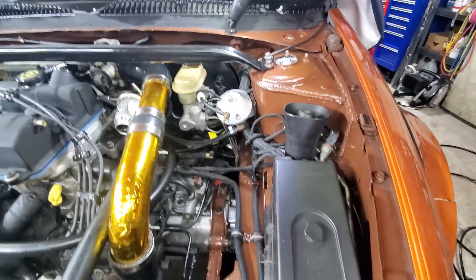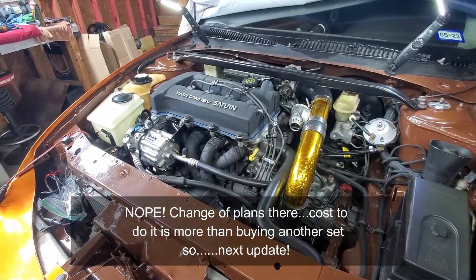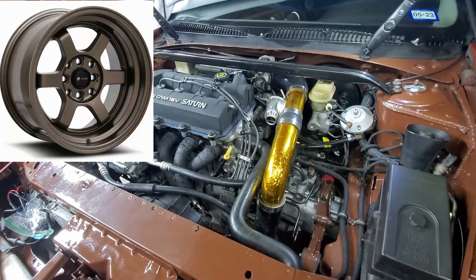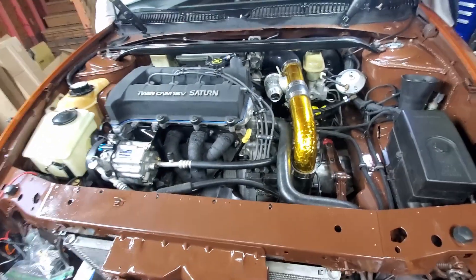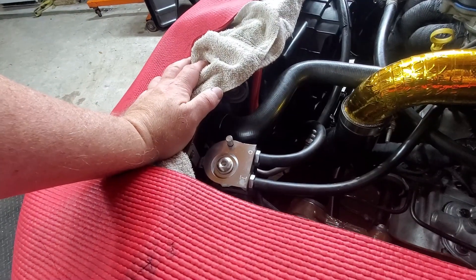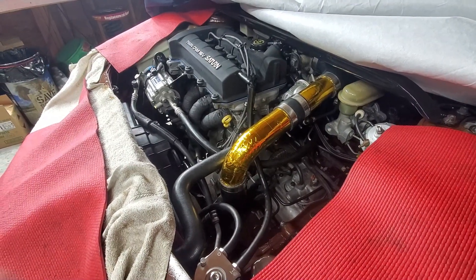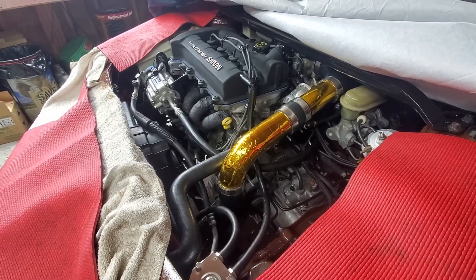Next I'll be shipping the wheels off to get them bronzed — I want bronze-colored wheels. After that, I'm going to take it out for a drive. One other thing I need to do is set up the catch can. I looked up the STS catalog on how to incorporate or augment the PCV system with a rear mount turbo. In their kits they include a valve — a three-port, two-way shut valve — and a pressure switch.